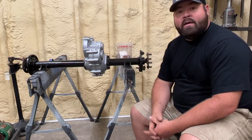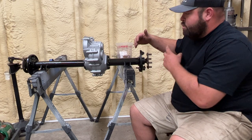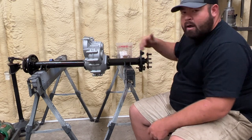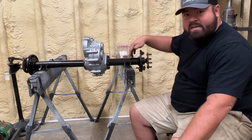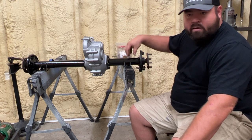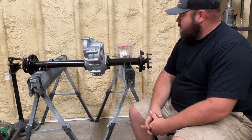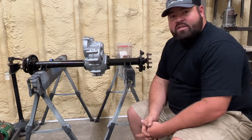All right guys, so we're done. It was a pretty simple process — just be sure that you have all the tools and all the parts before you start. I had to order collars halfway through this video, so this video took a couple of days to make. It's a simple process to replace the bearings and the collar, and I just reused the C-clips that were already in there. So I won't have to worry about the axle screaming when going around curves anymore. I appreciate it and we'll see y'all there.